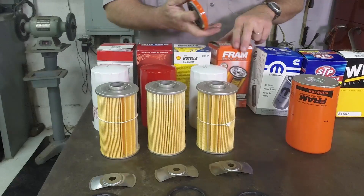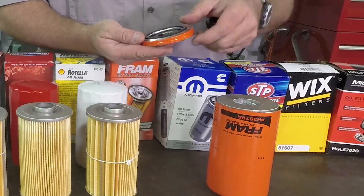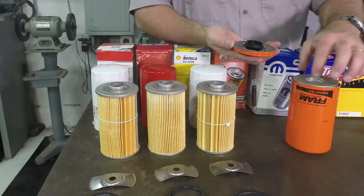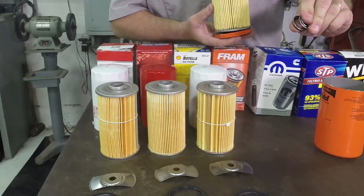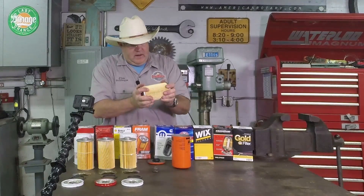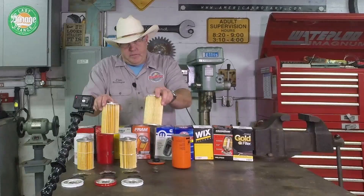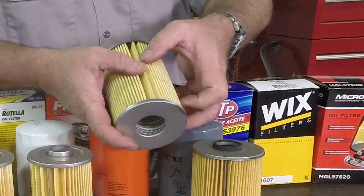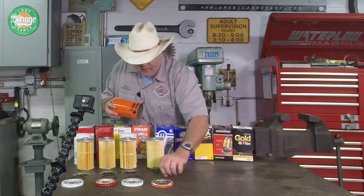Let's go to the Fram. The Fram filter is a little bit different inside. This is definitely not as heavy as the bases on those three. The rubber O-ring is crimped and everywhere there's a crimp point it's kind of swollen the O-ring up, so it's not consistently round. There is a joiner here. This Fram does have a proper spring in it — a nice heavy spring at that. The filter appears to be pretty high quality for what you would expect from a Fram. The pleats are fairly consistent all the way around and they're much tighter than the pleats in the other group. There is no joiner bar to join the pleats together — they're just glued. The can is basically the same quality as the others.